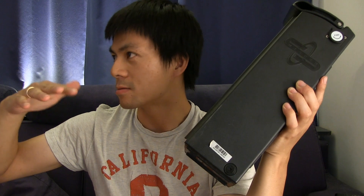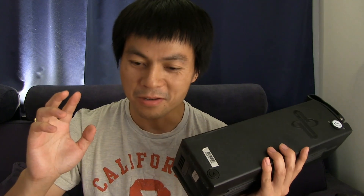How did I kill this battery? There are mainly three reasons. First, I noticed that it performs better when it's fully charged. And I live on a hill, so I would have a lot of downhill going to work. I would bicycle to work and charge there — I only charged at work. Then I would bicycle back up with a fully charged battery. But that means I charged every day at work. I only bicycle about six months a year in the summer, which means the battery would get about 100 full charge cycles per year.